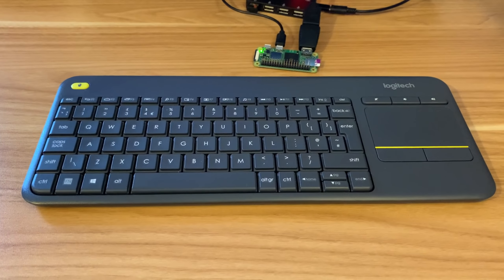I've booted up my Pi Zero 2W to talk about screen resolution, which makes a huge difference to performance. Currently running at 1920×1080, but if you want the Pi Zero 2W to perform faster, go into preferences and lower the screen resolution. I can drop it to 1280×720 — it doesn't look quite as good but video performance will be better, apps will run better, and games will be way, way better. I often run games as low as 640×480 because retro games used to run at lower resolutions anyway.